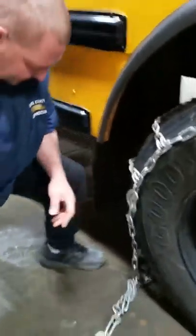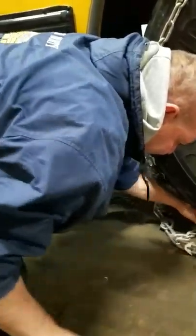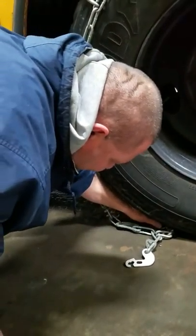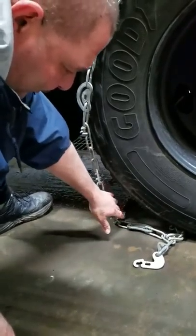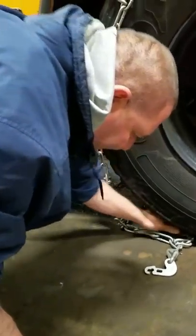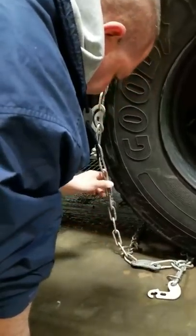I'm going to come down here and take the bottom link, take this hook, put that to the inside of the tire, and wedge that link right up underneath the tire. What that does is stabilize the entire chain so when you start backing up, it won't flop around. Tuck that in, hold it straight, and make sure your hook and cams are out from underneath the tire — if the tire runs over them it will bend them and you won't be able to hook it right.